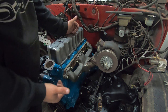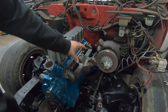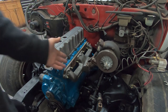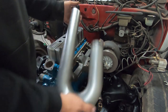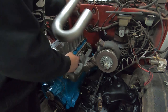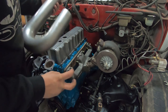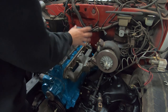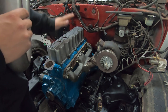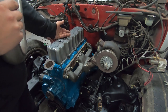What I want to do instead is just make a simple tube manifold to fit in here that I can mount my throttle body on top of — be it in the middle or somewhere forward. I'm going to try to build it out of this tube. I think the 90s will have enough radius to make one nice two-and-a-half inch log type manifold. For this season, I'm just going to keep it throttle body injected like the factory 2.5 for simplicity. The factory computer with the tune I had should run this engine without many problems.